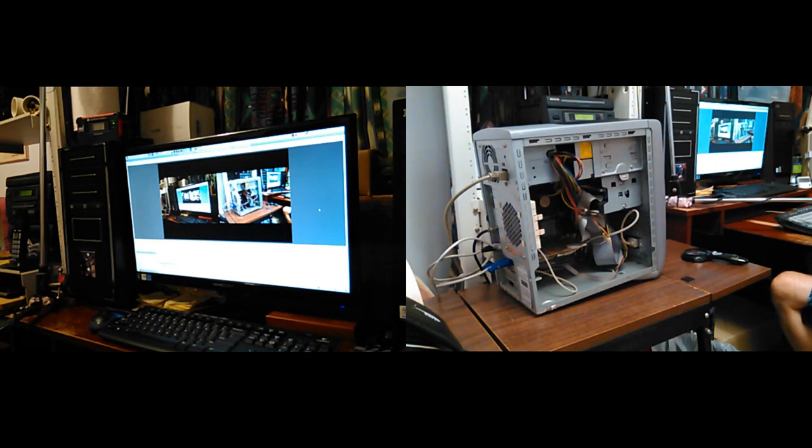Don't know why I don't get video. That's pretty odd. Usually, you know, even if it won't boot, you get the BIOS or something. Something like that happened on, I had two old Pentium 3s out in the garage that I did some videos on the other day. I powered them up out there. One of them wasn't giving any video until I got the, had two hard drives. One was going bad and the other one was actually a 250 gigabyte. And I don't, the BIOS, for one thing, I don't think the BIOS could even read that. I don't know if it'd read it at all. Anyway, after I messed around with the jumpers on the hard drives, it actually started throwing up video, so may not be the card.